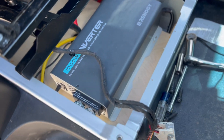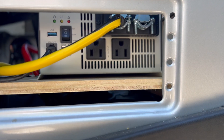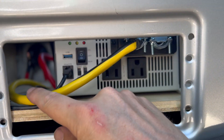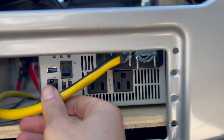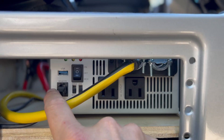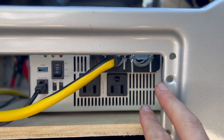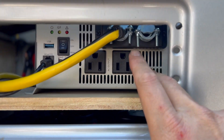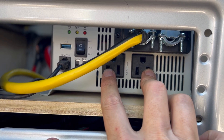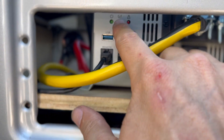Final step: putting the passenger seat in. The inverter's all plugged in. The 115 volt output is wired and run to the back of the van using this heavy duty extension cord, so it should be plenty for carrying the current. The remote cables are also run to the back — not plugged in yet. The auxiliary input I'm not planning to use, and the other two outputs are both available. It's switched on currently but you can see it's not on.